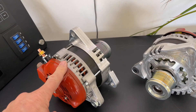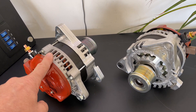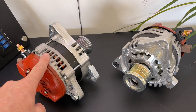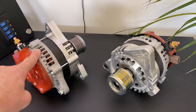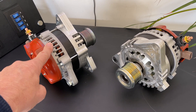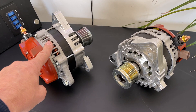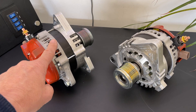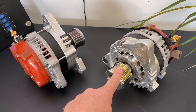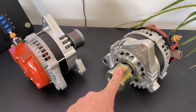Now the units here will do Scotty at 3,000 watts, or we can do a 12 volt to 12 volt at 1,500 watts. What's not well known is that the 12-to-12 and all the other DC-to-DCs are fixed — they're either on or they're off, full power or no power. But Scotty's variable power, so we can take say only three to four hundred watts out at idle, and all the way up to 3,000 at full revs. How good's that?